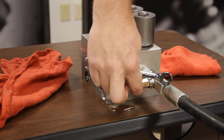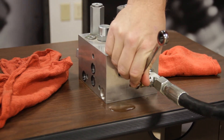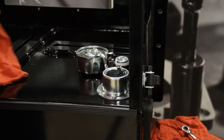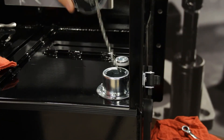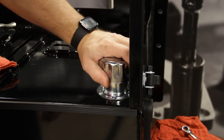At this point, you have primed the pump. Close the bleeder valve, allowing the system to maintain a pressurized fluid level within the lines. Remove the pressurized air from the tank and replace the reservoir cap. Your system is now primed.